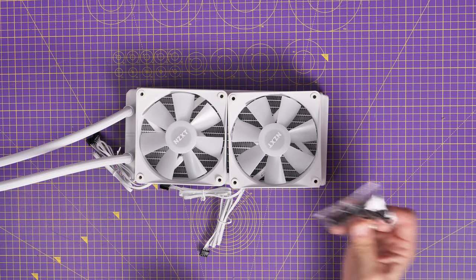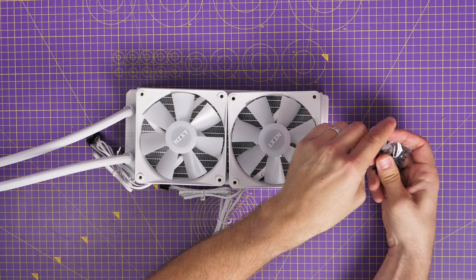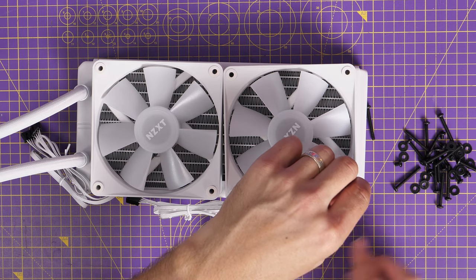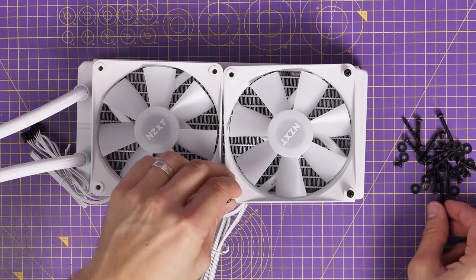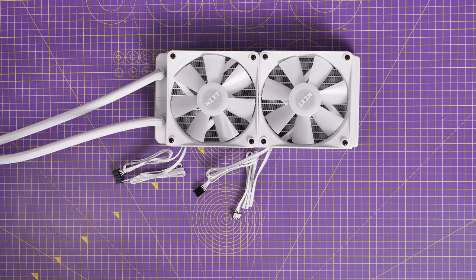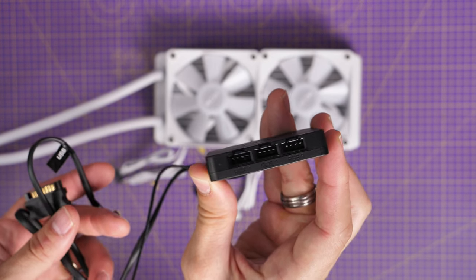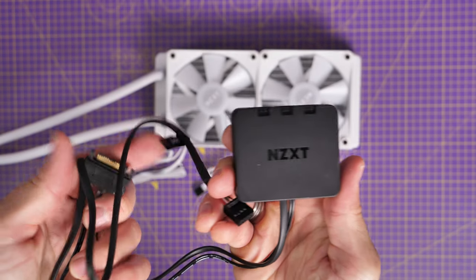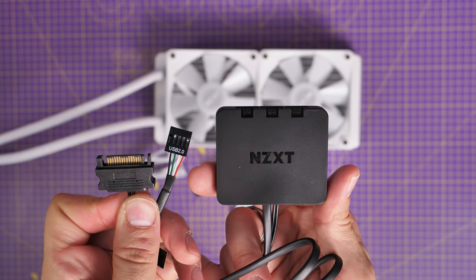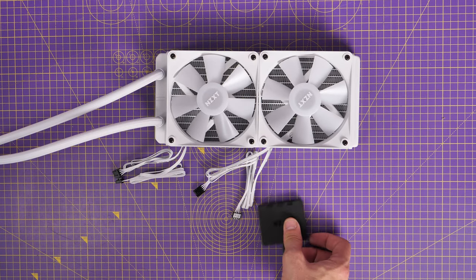There's a bag full of screws including long radiator screws — enough for push-pull if you wanted to add extra fans. The RGB controller that comes with the AIO has three RGB ports but you only have two — one from each fan — since the third is for the 360mm version. That controller needs SATA power and USB connection. Once again we've now got 240mm bottom fans with their controller, two radiator fans with their controller, and three front case fans which you'll need to figure out how to connect to a controller to sync everything via CAM software — which requires an extra purchase.